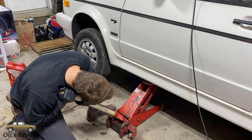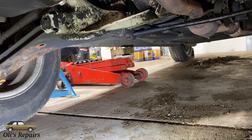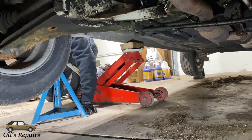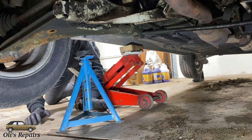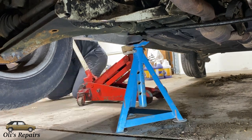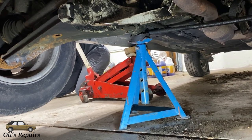It's best to have two people so one can watch while you're letting it down. Just be careful and go nice and slowly. Here we're doing the other side, jacking the car up again. I have a second person watching the jack stand on the first side, sliding the jack stand underneath the control arm mount with our little rubber on top and letting it back down, keeping it nice and controlled.